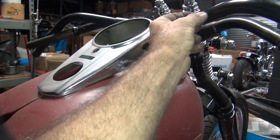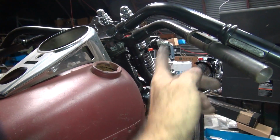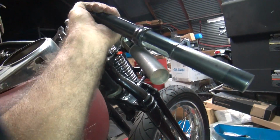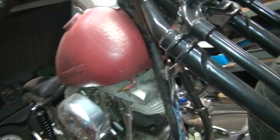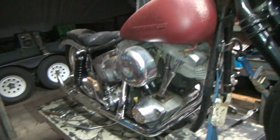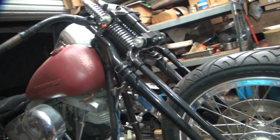Just cut them right here. You can make that way down to here if you want. Kind of what they did on that, but they got it welded at the wrong angle. Or I can just take this bar and tweak it up, which might be what I do anyway. Depends on what I'm going to use. Either way, I want to use external throttle on this bike, like I did on my race bike. Worst case, I can cut that off. Internal throttles don't work very good for modern carburetors. They barely work for old carburetors.